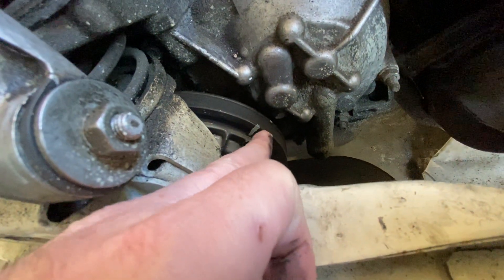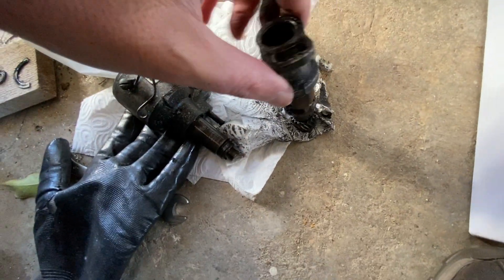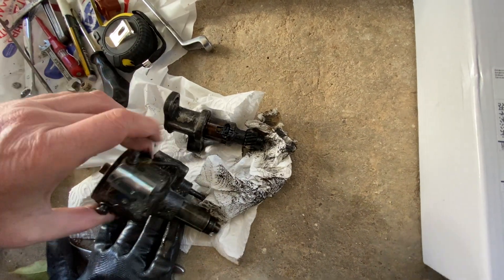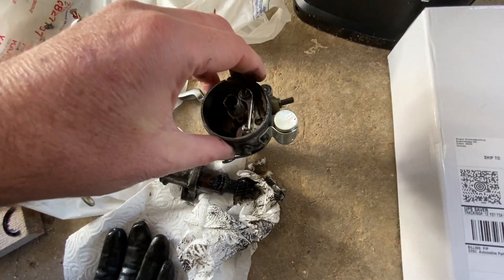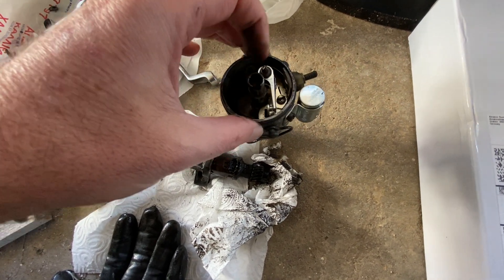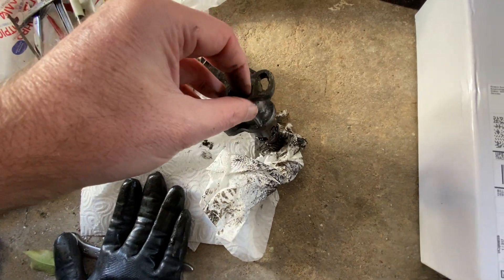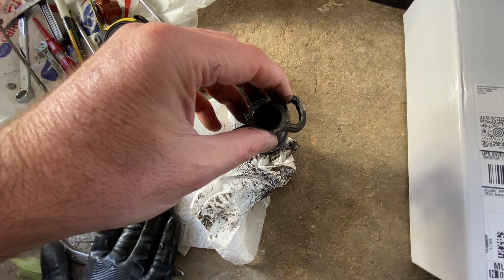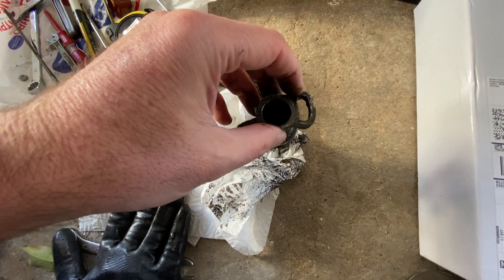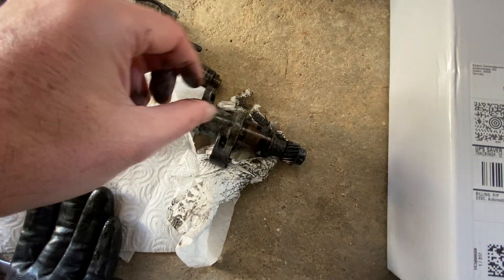Here we arrive at the part with teeth. I've already set it to where it's supposed to be for the first cylinder. You see this — this is where you turn the whole distributor housing to get the points opening exactly at that mark. But with this pin that slides in here, I was at the very end of its travel, so I cannot fine-tune the ignition.